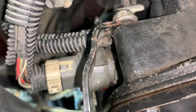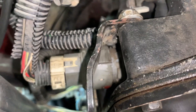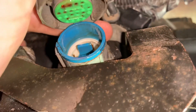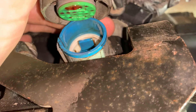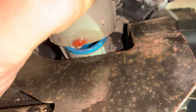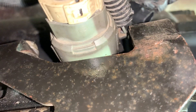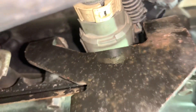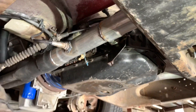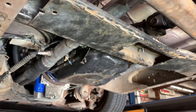And our connector — you don't really see it right away. Let me pull this out real quick, I don't want to get fluid all over. Oh yeah, this thing is filled with fluid. See, that's the biggest problem — half of those pins are covered in oil. That's going to have those cross-leaking and cause all kinds of issues with this unit.